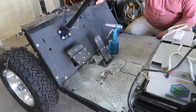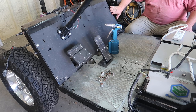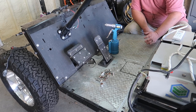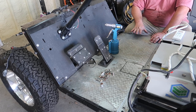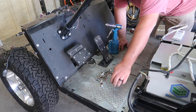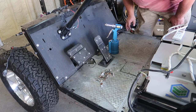Piece is drying that we just washed. We need to replace some rivets, two rivets on this. Looks like this firewall here to the front. We have a couple across the bottom and the back. I've drilled two holes on each side because this lower plate looks to have bent at some point, and I don't want that rattle that you're going to get when you're stepping on the golf cart like that. I don't want that. There's a couple at the front right here.